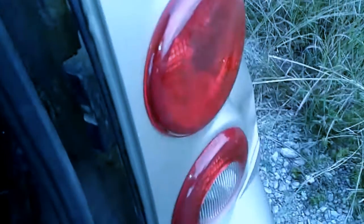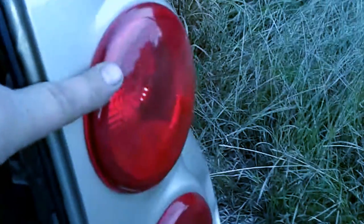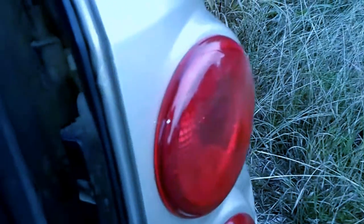We will order a tail light and change it by removing these three nuts — the light comes out the front. A new light goes in, three nuts tighten up using a 10 millimeter socket. I'll post a link where you can buy a replacement tail light assembly, the bulbs, and the tools to do the job.